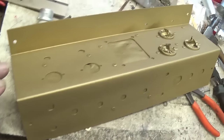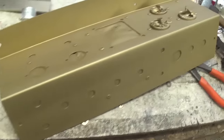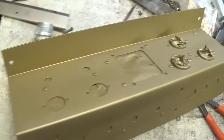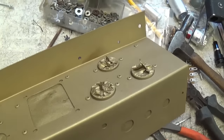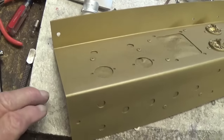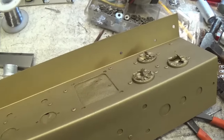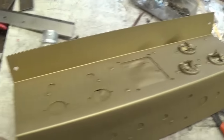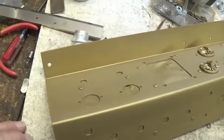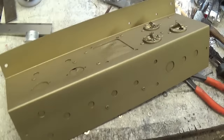Here is the painted chassis after a couple of coats of lacquer base coat gold. Lacquer hardens or dries very quickly, but I'm going to give it about an hour. You notice that it has no sheen, it's flat, which will allow the clear to adhere very well. The type of clear I'm using is automotive grade clear - it's very expensive, probably around $60 a pint. I have some left over, so I'm going to use it and we should end up with a really pretty glossy finish. Let's let this dry for about an hour before we do that.